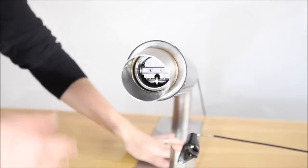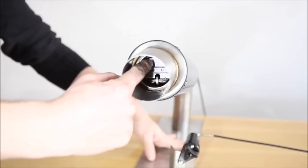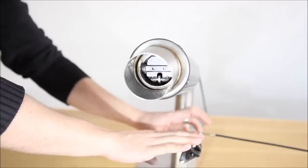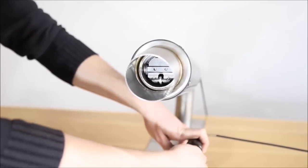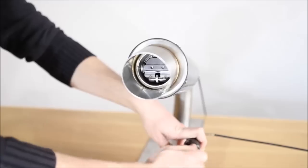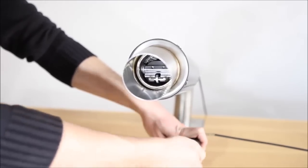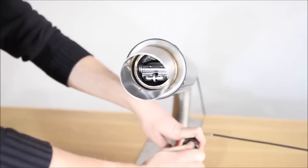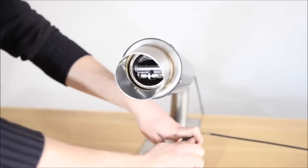I'll show you now how this adjustable baffle works. You can see now the baffle inside is fully closed, and I will use the hand control to open the baffle. To do this, I'll just turn the adjuster. Inside the exhaust you can see how the baffle slowly opens. This gives you the option to adjust the noise your exhaust makes in a stepless way. You can adjust it anywhere between fully closed and a fully open race system.